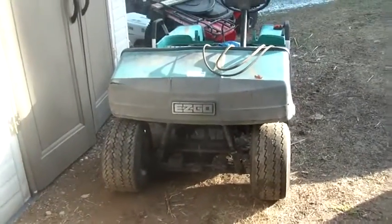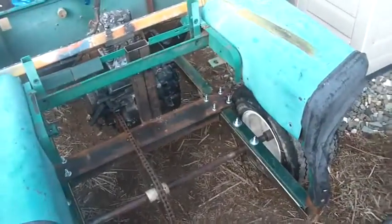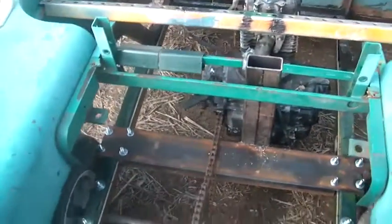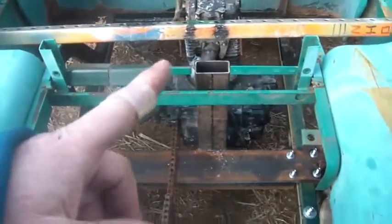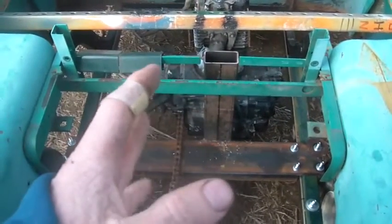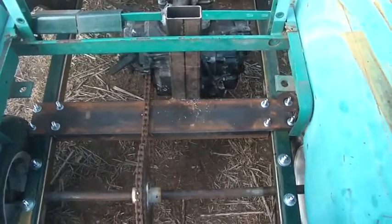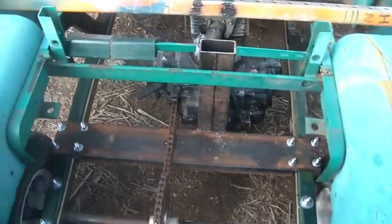Go say hi and tell him Harvey Spooner sent you. Today we're going to talk about this creature — you'll notice it's not in the garage and it's got four wheels now, which means it's a roller. When you put one of these things together there's quite a bit of fussing around to make sure things are parallel and level. If your axle and motor are not parallel, your chain will not run correctly — at minimum you wear sprockets, at maximum you throw the chain and beat up the case, snap the chain, or just destroy the cart.